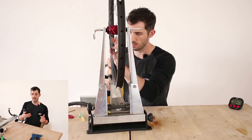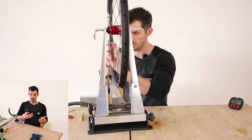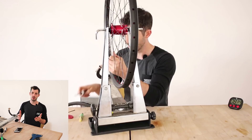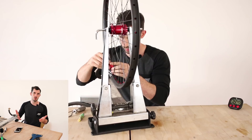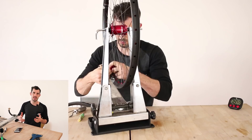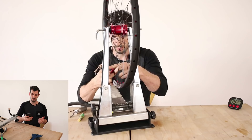Try All Tech asked if I've ever cracked a carbon rim running tubeless — no, I haven't. Dale asked about the difference between a tubeless rim and a normal rim. A proper tubeless rim won't have spoke holes and is completely sealed. However, most rims today do have spoke holes and many people run them tubeless anyway — you just tape them up. Gorilla tape works as well as anything, so a layer of that should make a normal rim tubeless compatible.